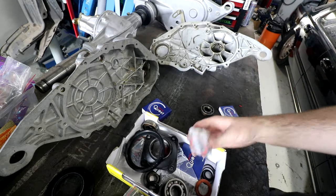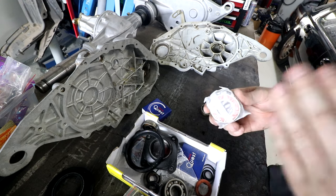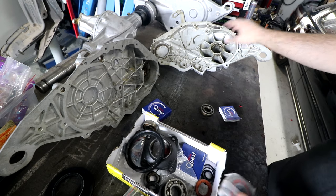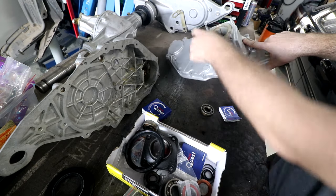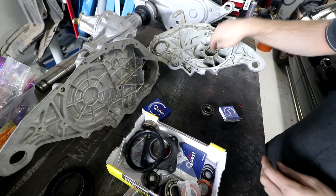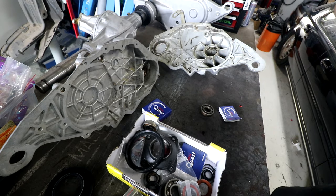Every modern car for the last 50 years has just used a sealed bearing, well, 50 years, but anyway, any modern car you've got has sealed bearings, modern bearings, modern grease. I think that's gonna be a better solution than having oil come out there, because that also adds another gasket, more seals, and more places for oil to leak. So we're gonna run the oil on the chain, and we're gonna seal the bearing inside for the wheel bearings. They're just gonna be standard bearings running in normal grease.